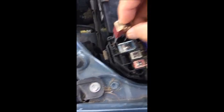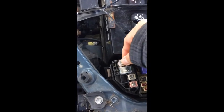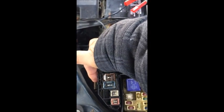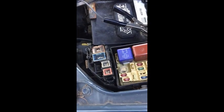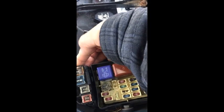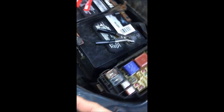I'll put that new fuse in there and just put the screws back — ten millimeter here and eight millimeter here, or you can just use a Phillips screwdriver. It's kind of a challenge to put the screws back; you just have to keep pulling this up a little bit and the cable is on the side.